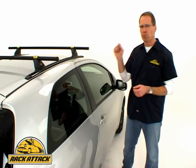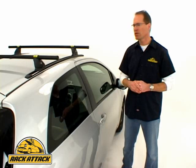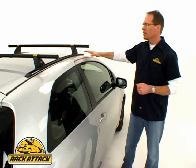In some cases, you may find yourself with a vehicle that has no listed fit for a removable roof rack system. In other words, the vehicle may not have a rain gutter. It may not have a clip that can safely attach around the door frame. For those vehicles, the best way to install a good, solid, multi-sport roof rack system is to install a permanently mounted track.